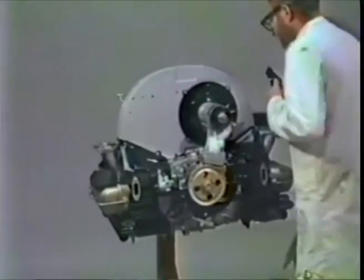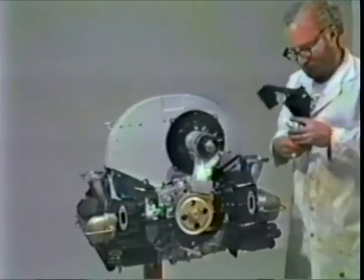Okay, we take the other side vertical piece and the side horizontal piece and go to this side, take our pair of pliers and bend up the bottom part of this, put it over, see if we have, oh, look at that, boy, it just snaps right in. Take the screwdriver, make flat the piece you bent up, like that. Take the side horizontal piece, and you're going to use one of these self-tapping screws on the side like this. You may as well use two of them. It makes it look symmetrical then. May even pass the Concours judge's scrutiny because it's kind of hard to see anyhow.